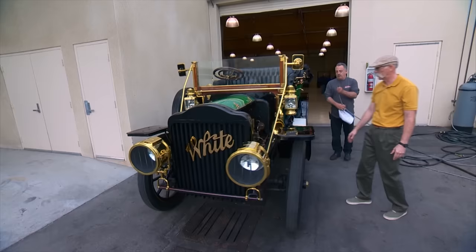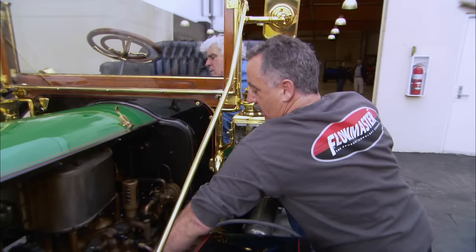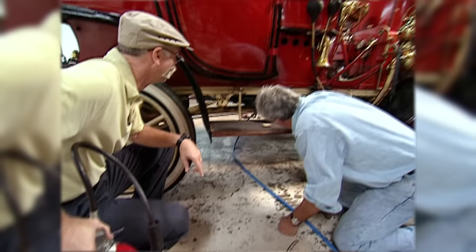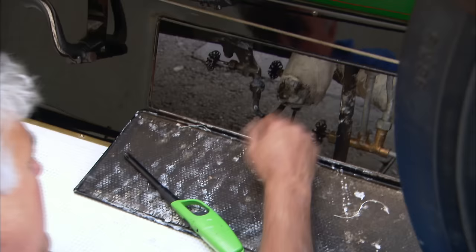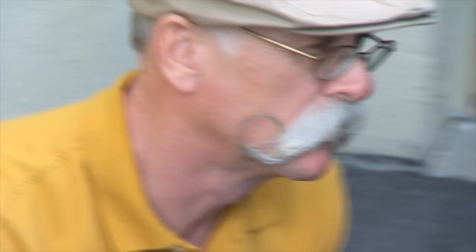Show you what your engine looks like, which certainly doesn't look like any conventional engine. Two-cylinder compound, high compression, low compression, 40 horsepower. This is the only steam car that ever had a transmission. What we're doing is we're pressurizing the pilot tank and the fuel tank. Here's the part I never liked — Jay with fire and flammable... This one doesn't backfire like the Stanleys, which almost took my mustache off once. Need I remind you that mustache wax is flammable? Just like lighting the barbecue — we've got a little fire going in there. Can you see the fire in that hole? That's your pilot.